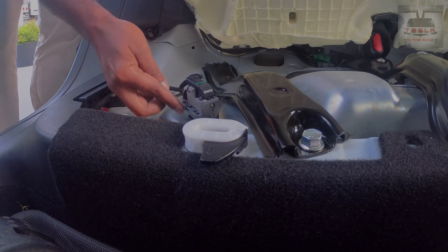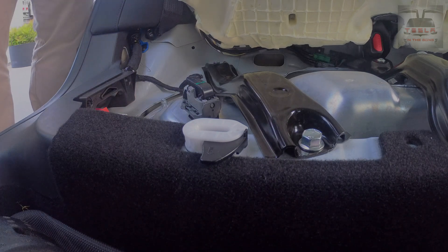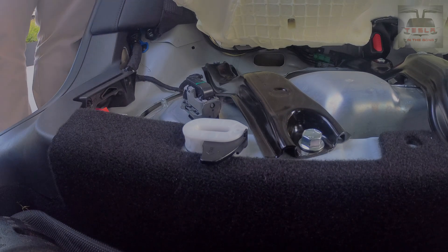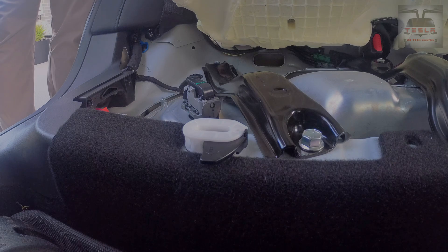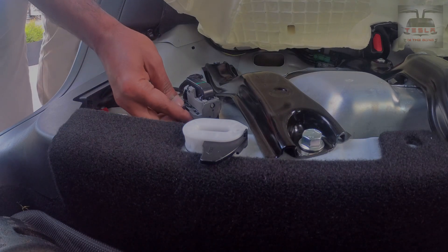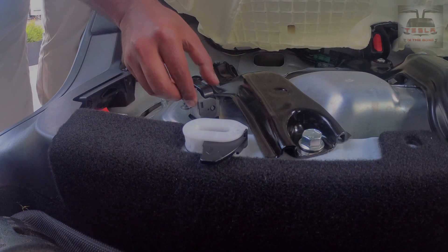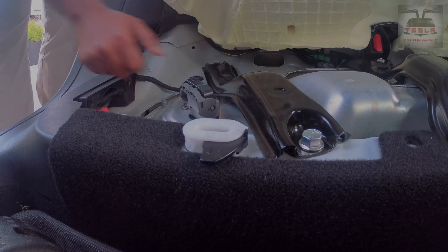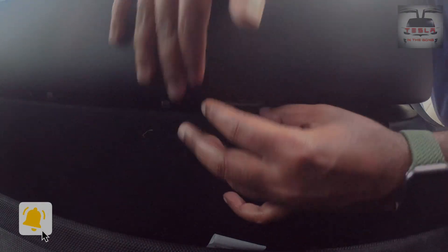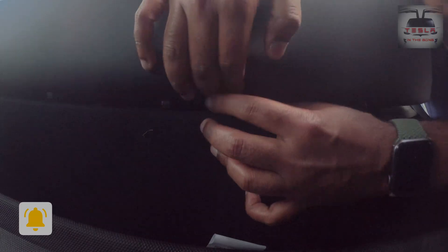You need not unhook your connector from the port. All you need to do is wait for one minute — you can use Siri to set a timer for yourself just like I did. Then swivel back the gray part of the connector until you hear the lock. In this instance you will not hear the loud thud, so do not worry. You can then go ahead and replace that black insulator that you removed previously and drop and latch the seat back into position.